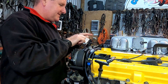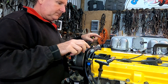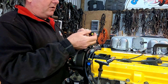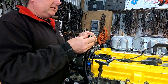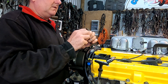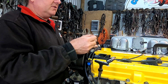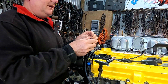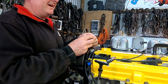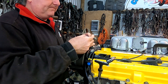I've already prepped the wiring in this case and I'm going to put — so the stepper is going to get voltage from the relay block. And then the other side is going to go to one of my stepper outputs — in this case a digital pulsed output, DPO — on the Haltech.